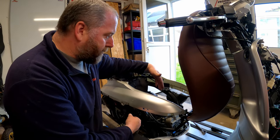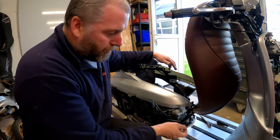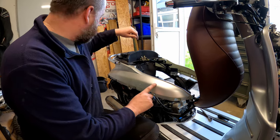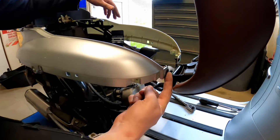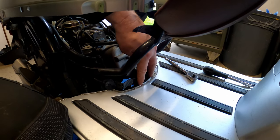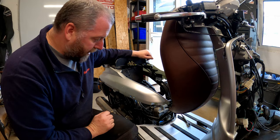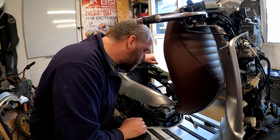The two lower side panels are now removed. We don't actually need to remove the upper ones — having checked the manual, we do need to remove the bracket for the saddle because it'll be in the way of getting the footboard out. To do so, there's a T25 screw at each side at the front of the fairing panel, plus a bolt on either side. I'll get those two screws and two bolts out and remove the seat and bracket, and hopefully we won't need to remove the upper panels.